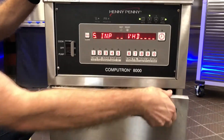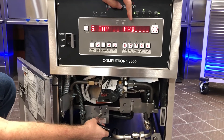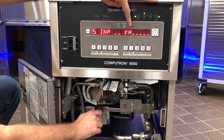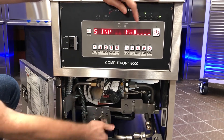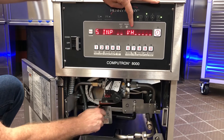I'm gonna open my door, and then as I open the drain valve, the D will drop off, indicating that my microswitch is working properly. Close it again — D reappears. So open, close.